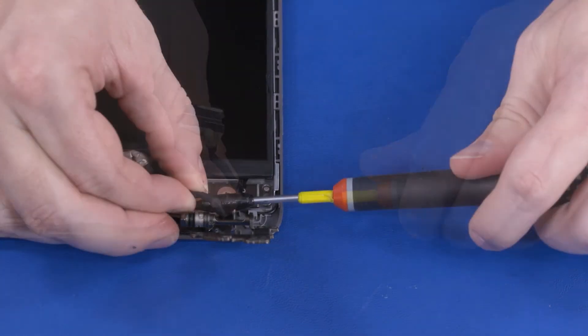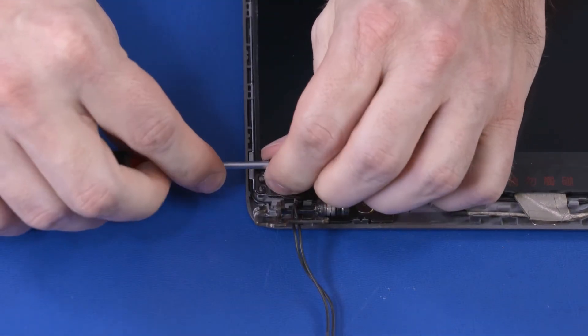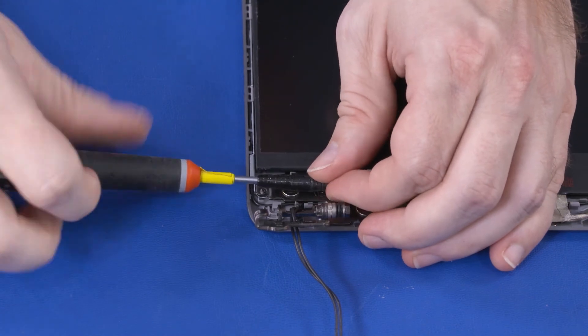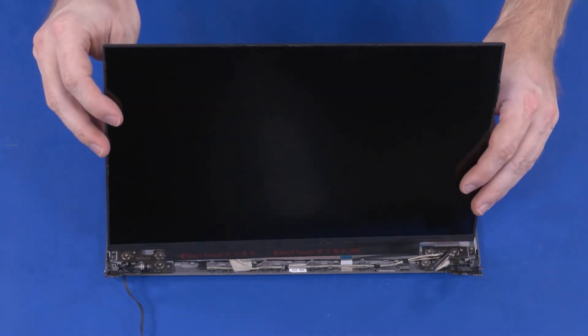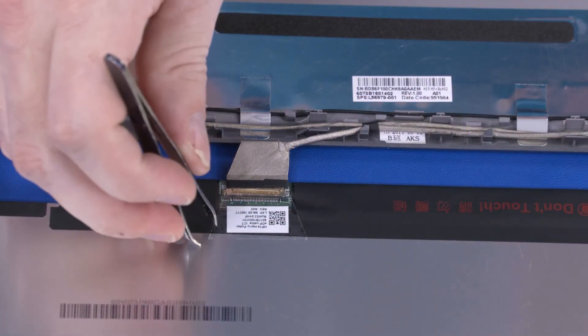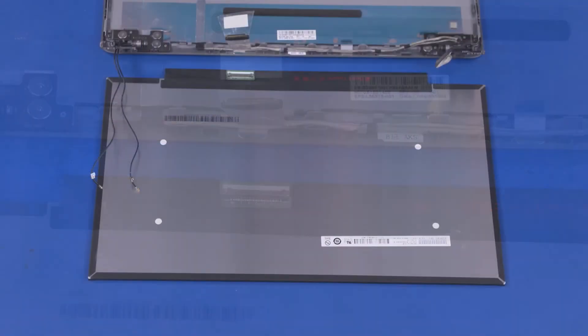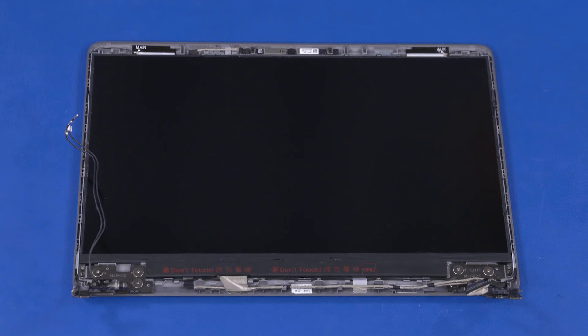Slowly twist the tool to release the tape. Continue twisting until the entire strip has been removed. If the stretch-release tape strips are pulled too quickly or at an extreme angle, they will break before releasing the LCD panel. The removed stretch-release tape is not reusable. Lift the LCD panel off of the display enclosure and place it in front of the display enclosure — take care not to scratch the LCD panel. Peel back the retention tape and disconnect the LCD panel cable from the connector on the LCD panel. Remove the LCD panel. Important: please refer to the maintenance and service guide for instructions on replacing the LCD panel, as the stretch-release tape strips must be placed in a specific orientation.